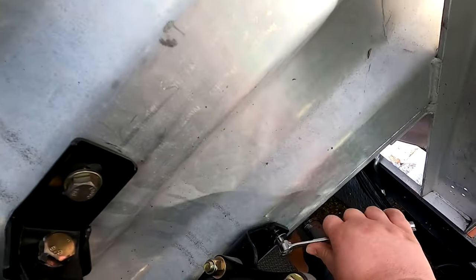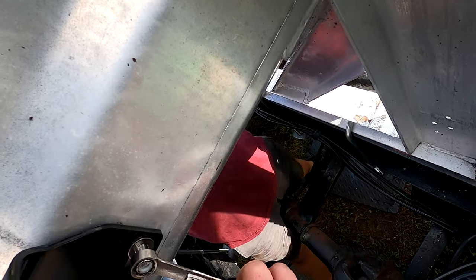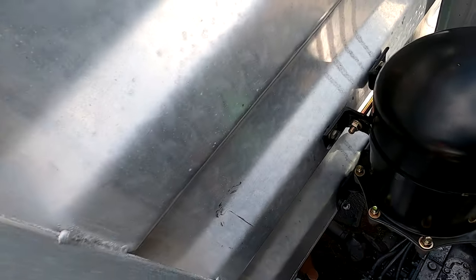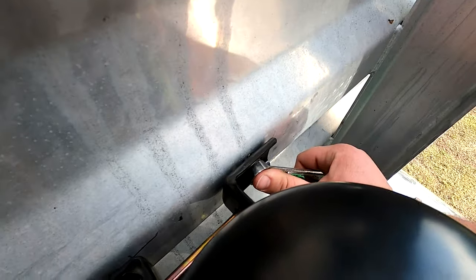Also, guys, while we're right here looking at the transmission, I'm going to look into converting this transmission into a 13-speed from a 9-speed. Don't tighten them up yet. Just get the nut started. You got them started? Yep. All right, let's take the top bolts out. Do this side first.